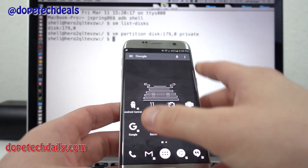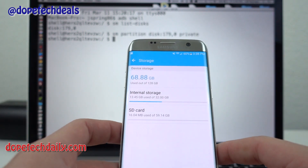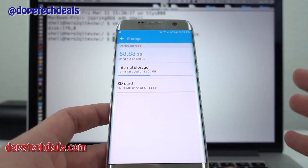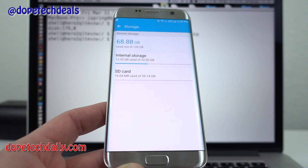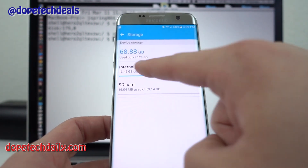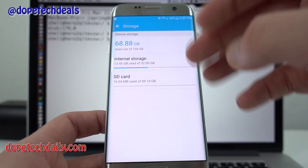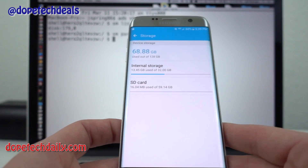Now if I go into my storage on the phone, you can see the adopted storage is there as expected. You'll notice the total at the top looks wrong — this is a small bug in the way the partition renames volumes instead of deleting and recreating them with the same name. It appears to show 128 gigs at the top, but the individual entries are correct: 32 gigs internal and a 64 gigabyte SD card. Those are your correct amounts. You can also install a third-party storage tracking app to keep track of usage.